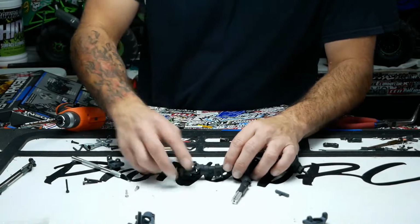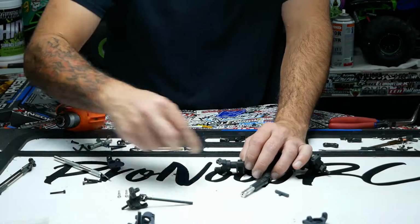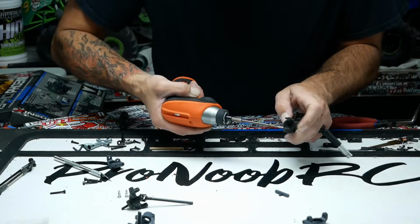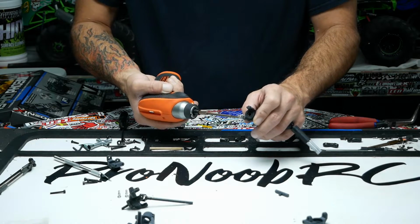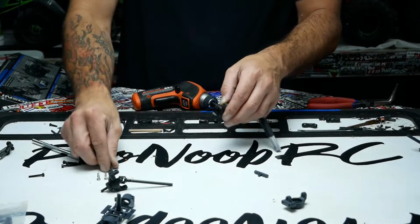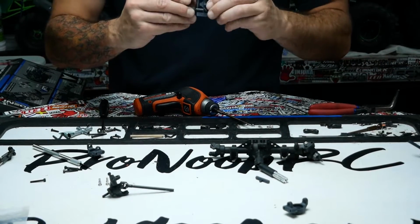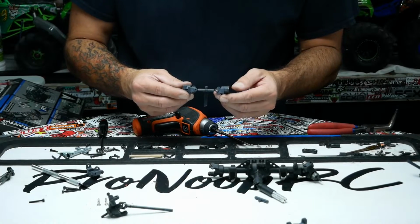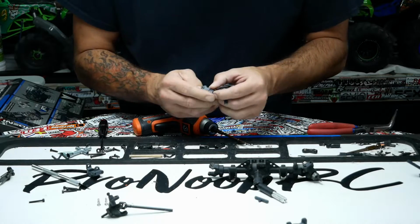So you can just go ahead, pull out your 2 kingpins or shoulder pin screws there, and pull out the whole shaft because we need to get the C-hub off. And there is a bearing on the inside. And you want to make sure you get the right one for the right side.